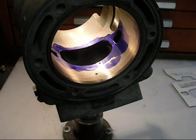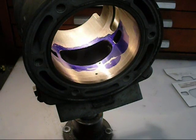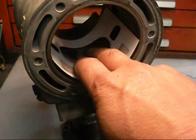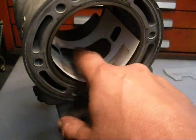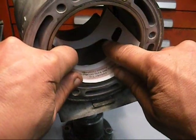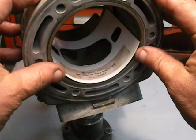The next step is to lightly grease the inside of the cylinder. The book calls for doing that, but we grease the back side of the template instead — it's the same thing and seems a little easier. Then the template gets laid up in here. Once you have your cylinder prepped and the Dykem is dry, put the template in and line it up with the sides of the exhaust port. Use a straight edge, pull your template back, and that's going to align the top. Then push the template down to adhere to the grease, maintaining the same height as set with the straight edge.